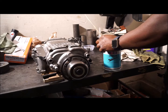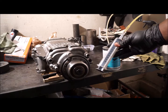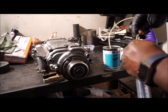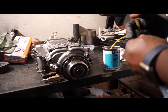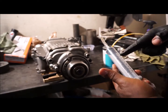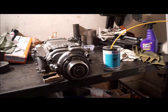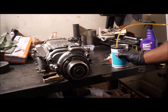I have an entry point for my Mobil jet oil. Now I'm going to use the syringe and extract as much jet oil - Mobil Jet Oil Number 2 synthetic - as I can, and fill up this whole tube. Once I get the tube filled up, I'll take it off and push it back in to fill the reservoir completely with oil. The new oil has a nice amber color to it, not the blackish-brownish color of the old oil I pulled out.